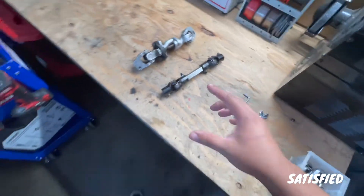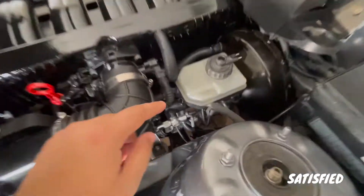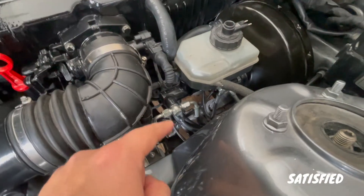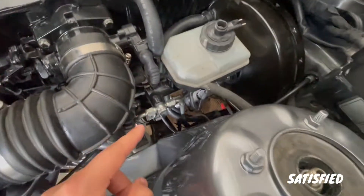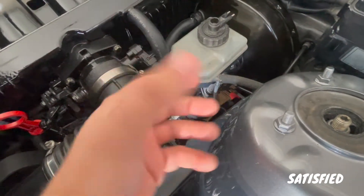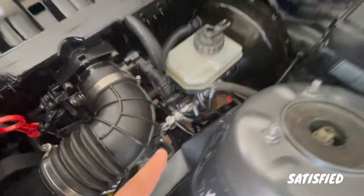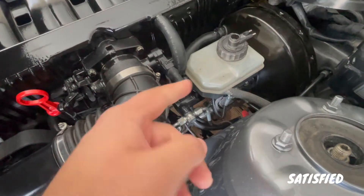I know this is made for track use, but for steering response I'd rather just go with the Condor Speed Shop one. You still can go with the stock OEM one — there are still companies that make bushings and you could shorten it or change the bushing and that could solve all your problems. But for me, I just don't like how the steering shaft looks inside the engine bay of this car. It takes up a lot of room and I think for steering response this will be way better. Now you guys know the difference between the stock OEM coupler versus the new Condor Speed Shop coupler. I want to show you guys how much space I have with the stock OEM one and how it'll be a big difference using the Condor Speed Shop one. I know for a fact this one needs to be replaced — the other day when I was driving the car I heard a lot of clunking coming from the steering column and a lot of vibrations from the steering wheel. I put my hand on the coupler and just grabbing it I was able to flex it a lot just with my hand, so it's not supposed to do that.